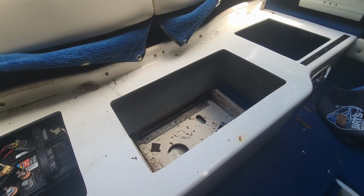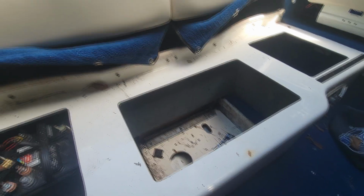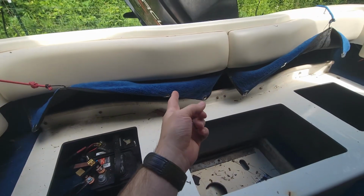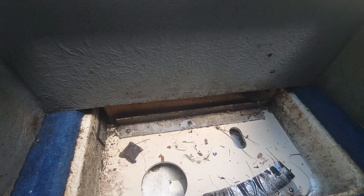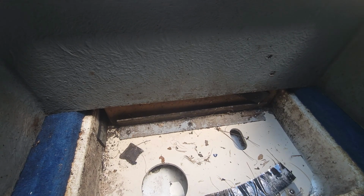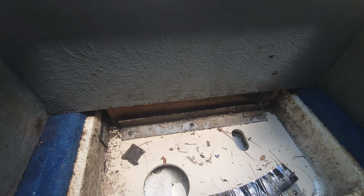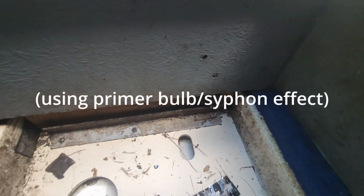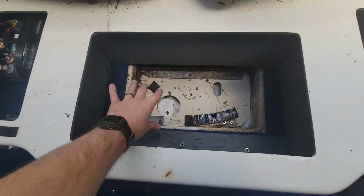I'm really lucky that I smelled it and didn't just disregard it, because when I got home I drained the bilge into a bucket and it was about 3 gallons of pure gasoline. This has a plastic tank, and everyone says plastic tanks don't leak. This one does. Before I drained the tank, I opened up a little storage compartment below the middle seat. It's got 4 screws. And I could see it dripping down the side of it.